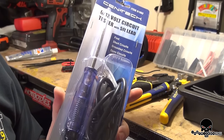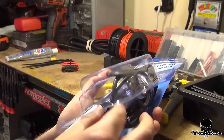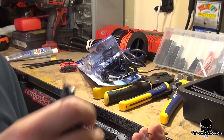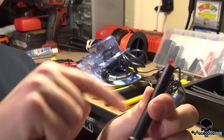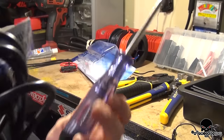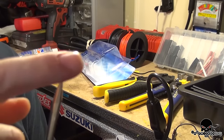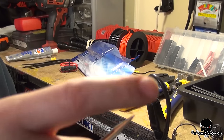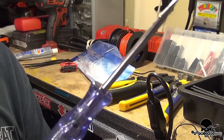If you're going to be fishing around for which wire you actually want to jump off of, you're going to need a circuit tester — 12 volt for your car. I actually have two of them here: a little one and a bigger one. You ground one plug and start poking around other wires. When you hit a power wire, it's going to light up the LED. With fans specifically — if the fan's not spinning, you can poke around all you want and you're not going to find any power. You have to wait until the fan's actually spinning before you can find power.